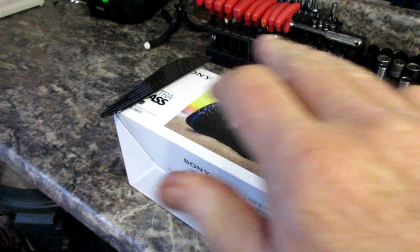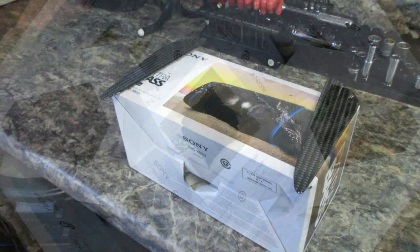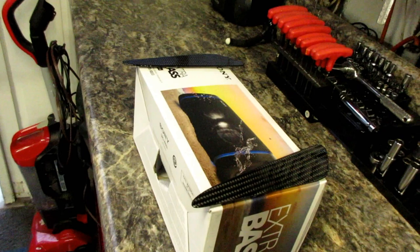That's going to have to sit in the garage overnight, and probably tomorrow we'll hit the whole thing with 400 sandpaper again and put another coat of clear on, just to give it that really nice look. The main reason for doing this is just to get those edges sealed — we don't want to see a dull edge like a little picture frame around the part, which I didn't find attractive.